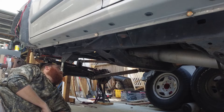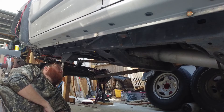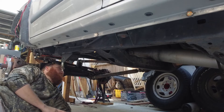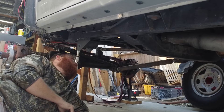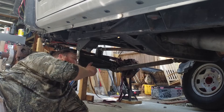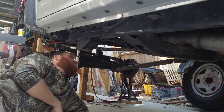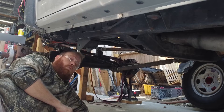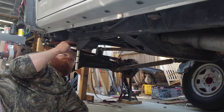Maybe I need to pull some measurements on my 6080 real quick and see where this ends up. I think it's only within about an inch or so of where it needs to be. I'll take this down — it's not going to go anywhere because it's kind of set on that side — so let me get that link off, pull my high clearance transmount, and we'll see what the rest of it looks like when I move this about two inches forward.